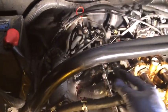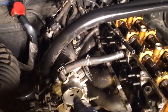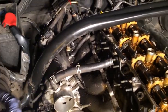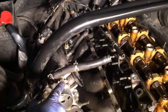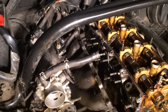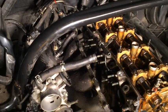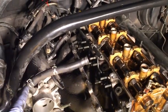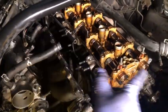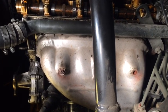The fuel lines are a little floppy here. In order to lean the intake manifold back, there is a 10 millimeter bolt on a clamp that holds the fuel lines to the intake manifold in the back. By undoing that, it allowed the intake manifold to come back and the fuel line flops out of the way better. Now I'm ready to start the other side.